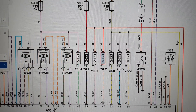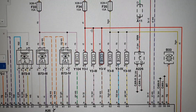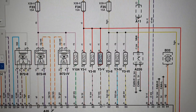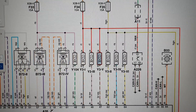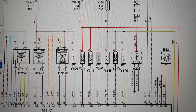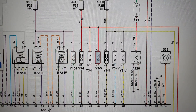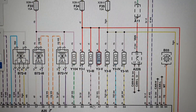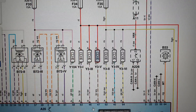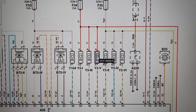The way this is set up, it's actually a relatively easy way to prove the whole system. If we put our scope on the command wire at the injector connector, we should be getting 12 volts — the fuse feeds 12 volts through the windings of the injector and 12 volts comes out the other side with the key on. When the computer wants to operate that injector it will ground that wire. So if we've got 12 volts there, we've basically proved that the rest of the system has integrity. Then we'll start the car and confirm PCM command.